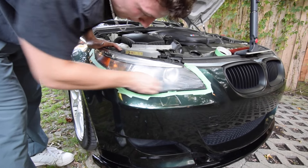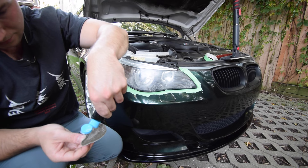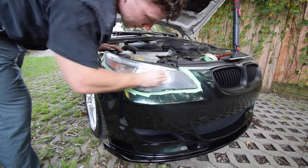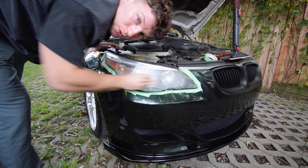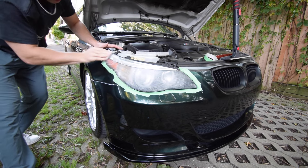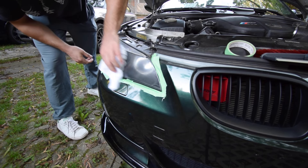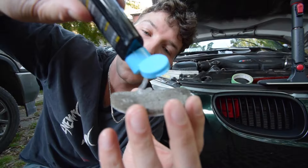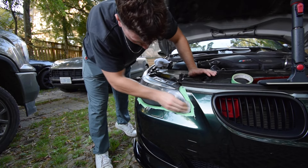We are trying to get this to a hazy white finish after wiping it off. We've got two of these, one for each headlight — really trying to get the corners. This is where that big blue faded spot was when we turn the lights on, so I'm going to put a little extra effort in there. I think I want to go over it one more time. It is looking white and hazy, which is what we should be looking for — so that's a good sign.